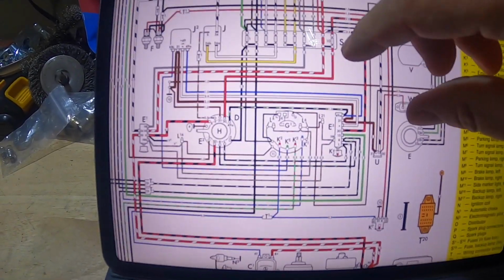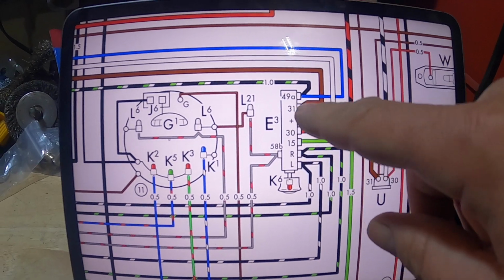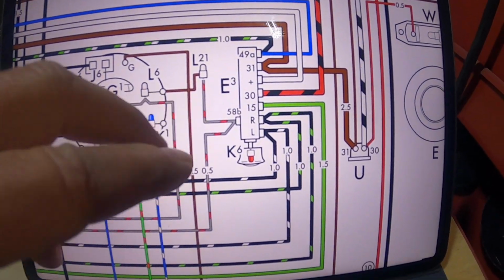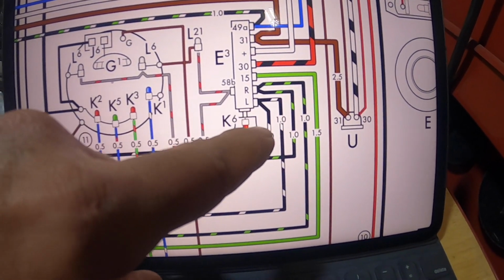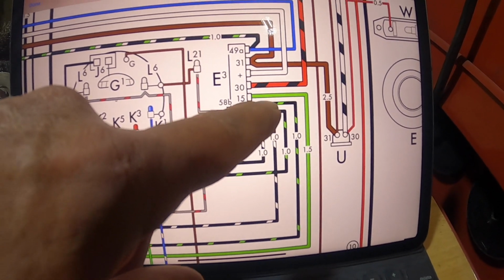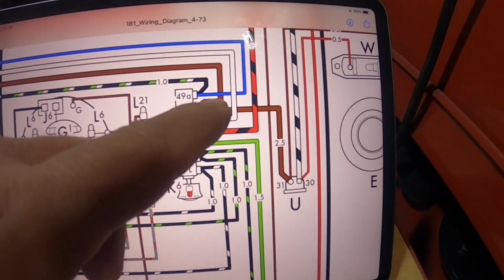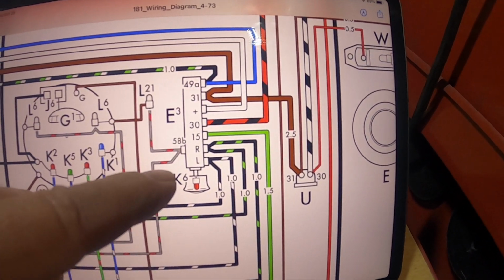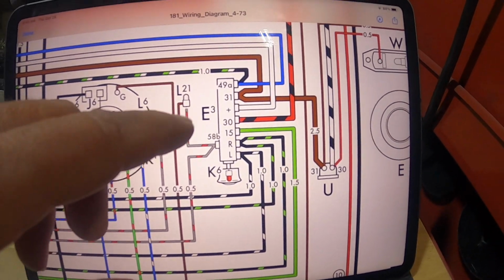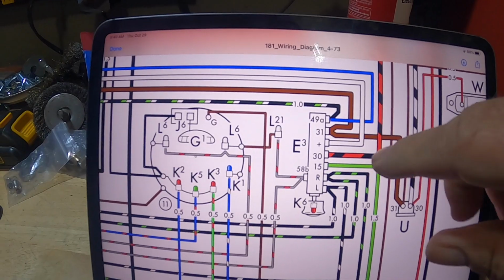Yeah, it's fantastic. This is the four-way flasher switch here. This is like the nerve center of the thing, because the thing is so minimal. But here's my left turn signal wires, here's my right turn signal wires, and then here's my flasher power, the blue coming in. So that's completing when I pull the switch on. However, it's kind of intermittent, so I'm going to take the switch out and clean it, clean all the contacts, put it back in just to be safe side.